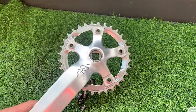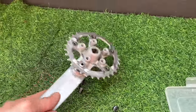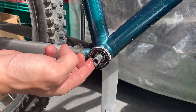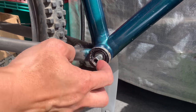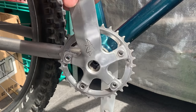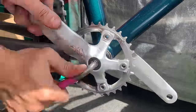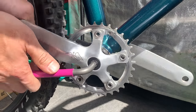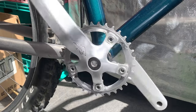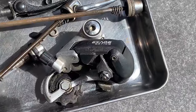After putting all this together I decided to go 1x7 — taking the other two rings off. Just going to try it with this chainring. It's not a narrow-wide, just a normal one, so we'll see how that goes. I had to use some smaller chainring bolts — if you decide to go 1x you might need those as well. Installing the crank on this side — looking pretty good, pretty happy with it. I still think there's a bit of wear left on this chainring so I decided just to run it. It's also really hard to find a 94 BCD chainring but they are around. The BB spins really smooth, there's no play in it — worked really well.